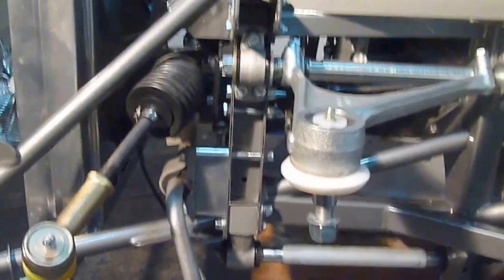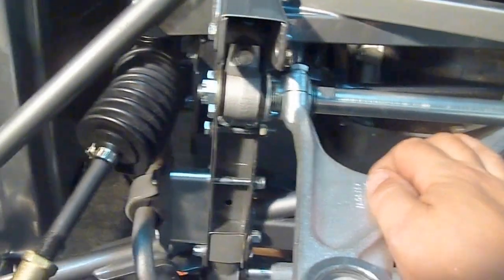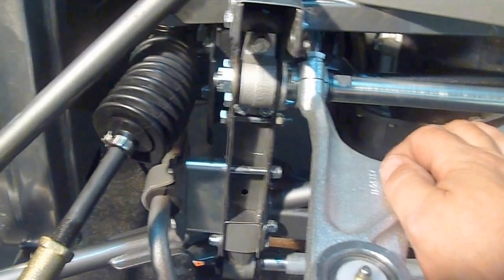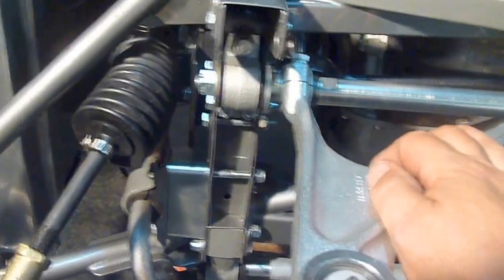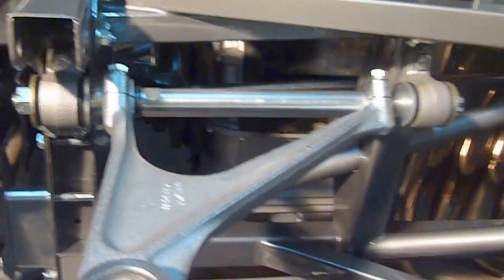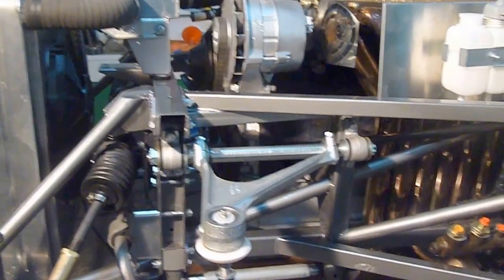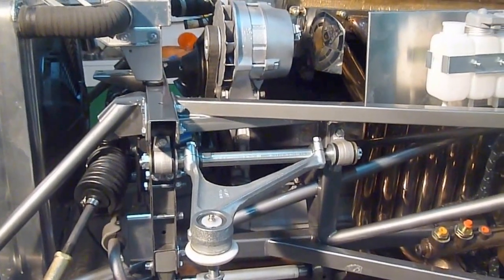See how that system goes together. And like I say, just be careful with the shims — just because I've used exactly the same shims, roughly to within 0.056 of a millimetre, it doesn't mean they will be perfect, but it should be a good starting point. I'm hoping the cambers and steering geometry are going to be okay — it's not a massive job to change it if needed. Anyway, thanks for watching. Keep tuned on Dave Jaguar 66, and if you like it, subscribe. Thank you to the people that have subscribed. Dankeschön — bye for now.